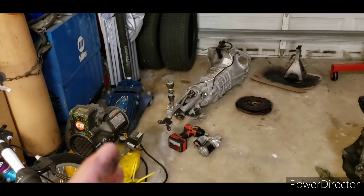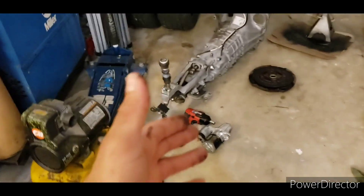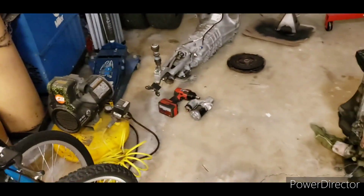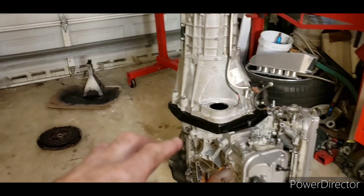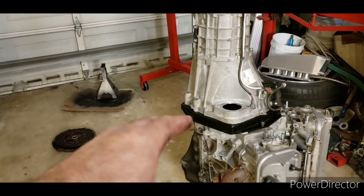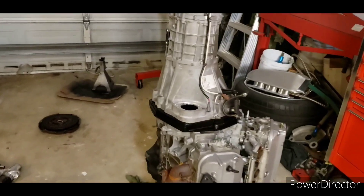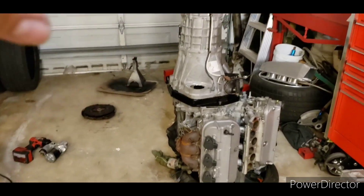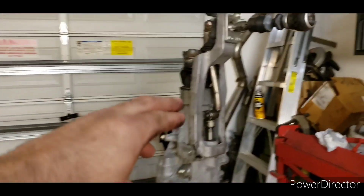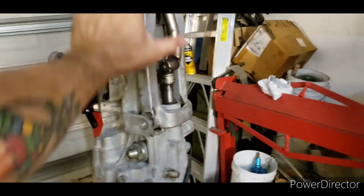These transmissions are small, lightweight, six-speed, and you can find them a dime a dozen. The best part about the swap is the starter placement. Here it is on the motor — the adapter is roughly an inch and a half. Depending on how far I can push this engine back into the firewall on the truck, I might have to shorten the linkage, but I've got four inches on each side so that shouldn't be an issue.